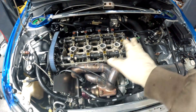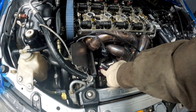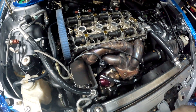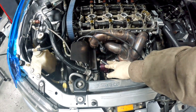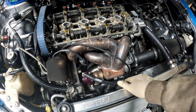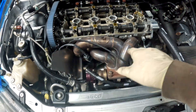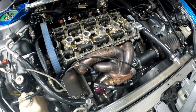The title of this video is probably going to be 'the customer wanted to gamble.' Coming back to the top end — everything's wrapped up. We got the STM FP dump-style downpipe installed. I put about 24 and a half pounds of spring in — he had two springs before, now we've got three springs, so 25 pounds of boost is the minimum. This will be E85-only so that's not an issue. I also changed to pneumatic lines and put DEI heat sleeving around them so we're not melting any wastegate lines, and I fixed the oil leak using those Mitsubishi rubber grommets for the turbo drain.